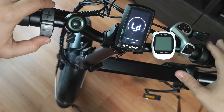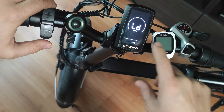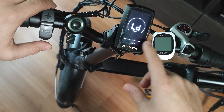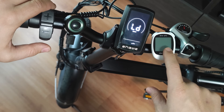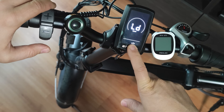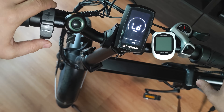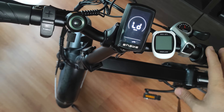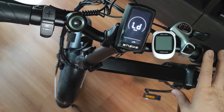If you have a GPS, you can finely tune the wheel size setting to get even more accuracy. But 24 is generally okay — as you can see in my full video review, the speed on the display is very similar to the GPS speed, so it's properly set at 24. Be sure to follow my next uploads where I'll add more info about this bike — see you and bye bye!